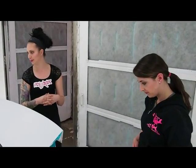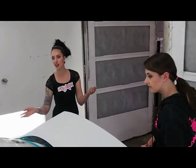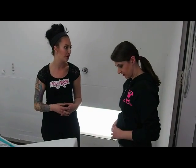No, it's a time-consuming process, but if you take your time and do it right, you shouldn't get any overspray anywhere. Once you do it enough, you get the hang of where you're supposed to put the tape. If you do it a couple times, you'll know how to do it. To do this car took probably about 3 hours to mask up for a complete paint. It's time consuming, but it's better than getting overspray and then spending the time to clean it off. Right, or just having to replace a part because you got overspray on it and it won't come off.